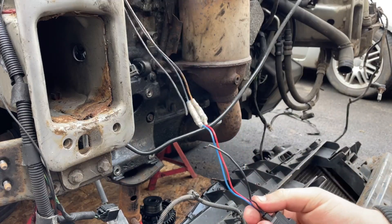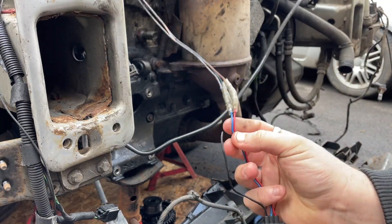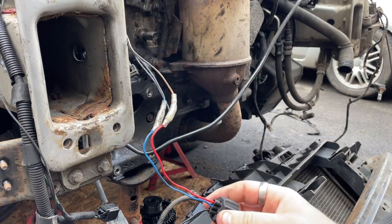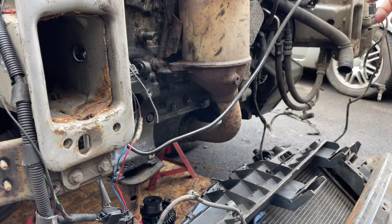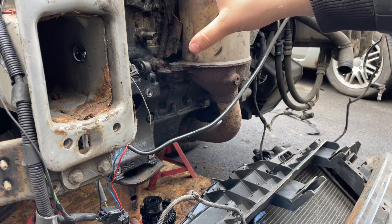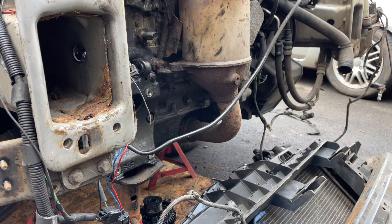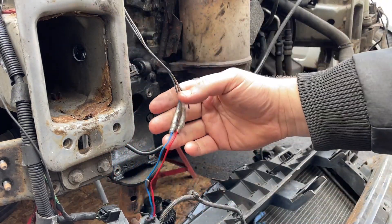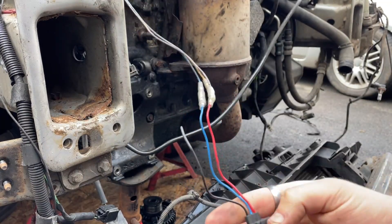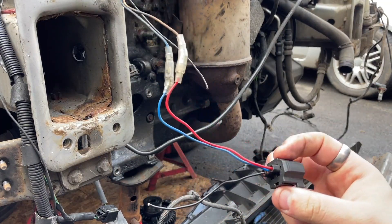There are a couple of reasons I'm doing this. One, these couplers are not waterproof - I feel like they're amplifier cables that probably shouldn't be used externally. They probably fixed the problem for a while, which the previous owner mentioned, but the problem is still there. The other issue is there's a severe oil leak on this side of the engine - the alternator could have actually broken down inside from being covered in oil. I've got a spare alternator but the wiring needs to be sorted first because it's not safe - it's rusting on the inside. I've been learning how to solder and now I'm going to give it a proper go.